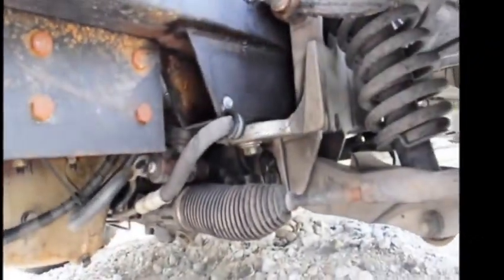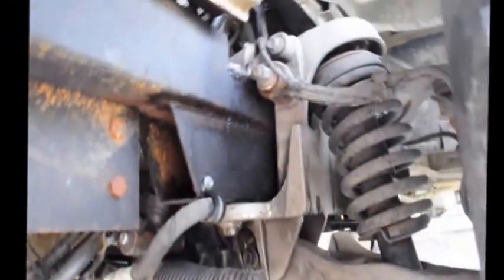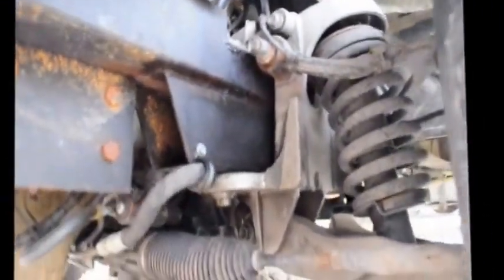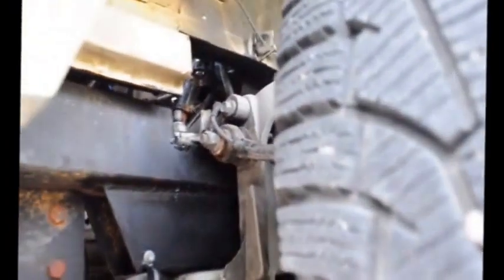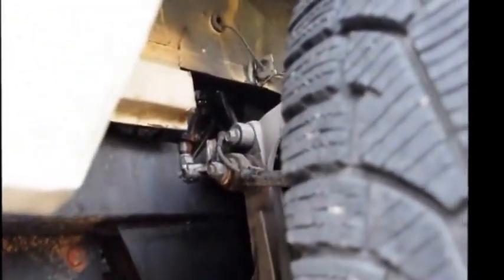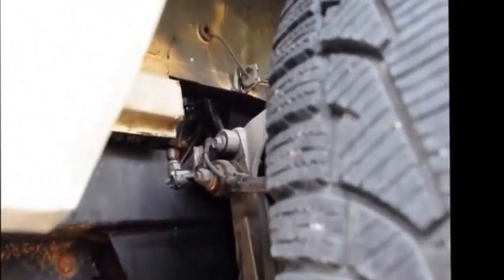There's an oil pan. Here we've got the Crown Vic rack and pinion system. You can see where that Crown Vic suspension is bolted through the frame all the way to the top, locking it into the frame. I had to cut away a section of the Lachero's original wheel well so that the upper arms could be adjusted and everything fit smoothly. And that's the Crown Vic suspension.